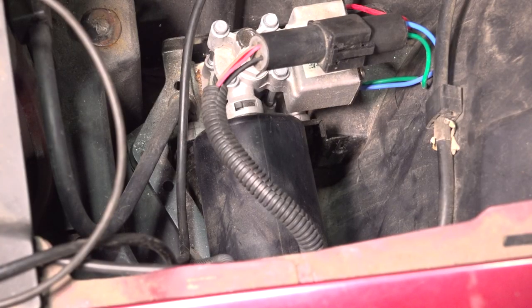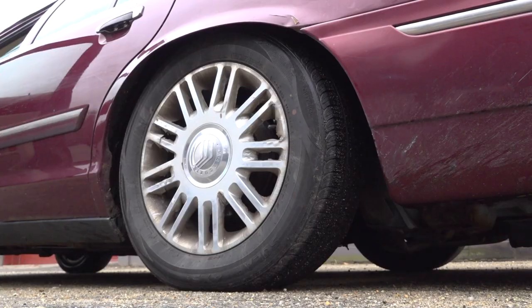Now let's talk about air leaks. Assuming you can hear the air compressor running but you find that the vehicle is sagging in one direction, or the system inflates properly but you can hear the air compressor turning on and off repeatedly — that essentially means you have a leak somewhere and the compressor is doing too much work, which could potentially get it burnt out.